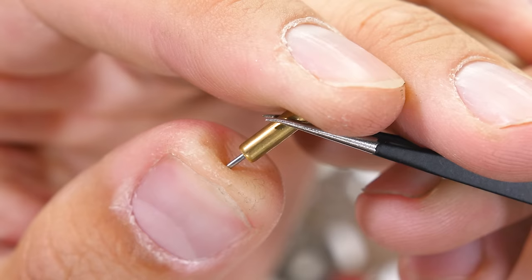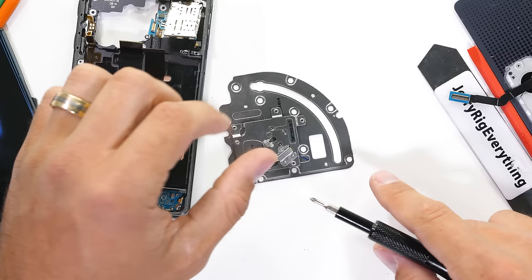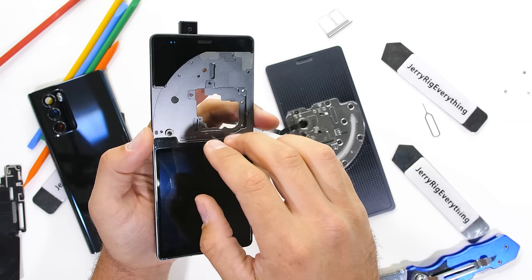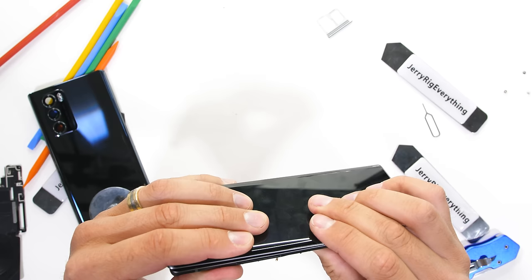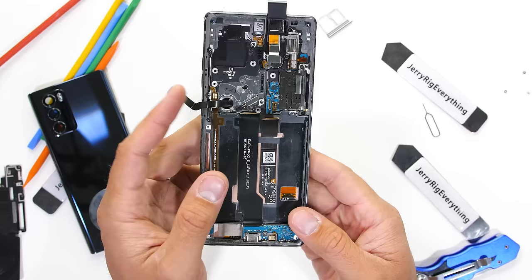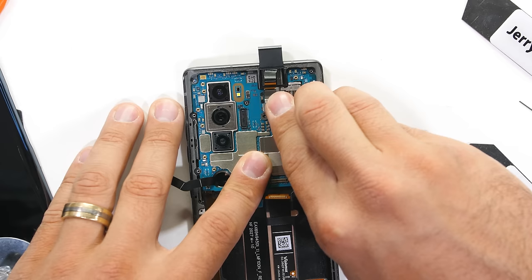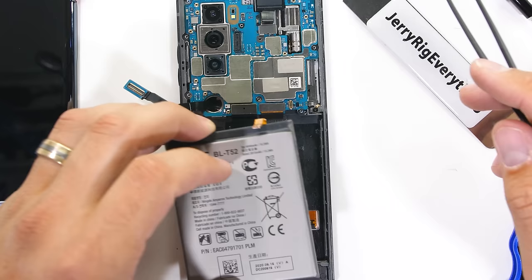It's going to be really crazy if I can get this whole thing put back together and functioning again. I'll feed the top display through the hinge and get that screwed down. The top display is 6.8 inches and the bottom display, which is still attached to the frame, is just about 4 inches. Getting the curved metal guiding slot in the screen lined up with the metal post on the phone body is probably the trickiest part of the reassembly. But once I feel it click in, everything else just falls into place. I can attach the spring portion of the swivel hinge back to the frame from the inside. The motherboard goes back in with the pop-up camera and all of the little Lego-style ribbon attachments get clipped in. I'll lay the battery in place and get the wing screen ribbon connected.